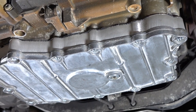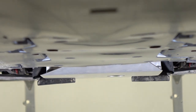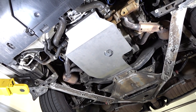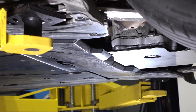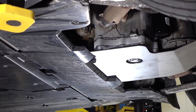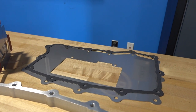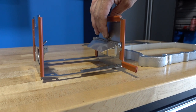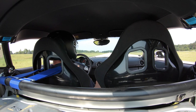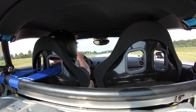And that's it. The job isn't hard but it does require care. There are other ways to fix oil starvation and cooling issues — with oil accumulators and adding a third central radiator — but installing the deep sump kit improves several things at one time. It adds 2 quarts of extra oil to improve cooling, the anti-slosh tray to prevent oil starvation, and the motorsport-style baffle to improve oil flow within the sump. It's a clearly beneficial upgrade for Boxsters and Caymans from 1997 to 2008 that are driven hard.